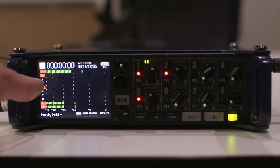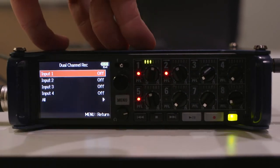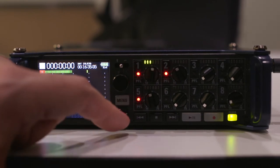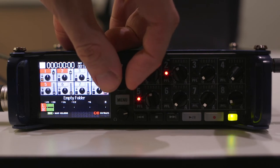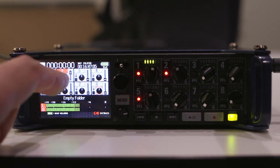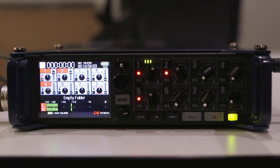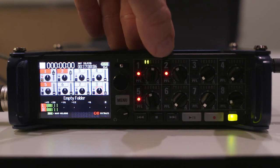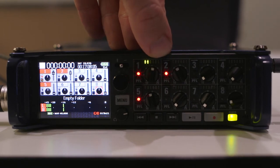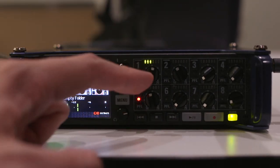When you go back to Menu, notice D1 — the mirror of Channel 1 — no longer exists because we've deactivated it. You can reactivate Dual Channel Record any time via Menu, Record, Dual Channel Rec. We also have Input 2 which is live; if you were to plug in a lapel mic, you would have armed that channel. Since we have nothing plugged in, we'll turn it off by pressing the channel number.